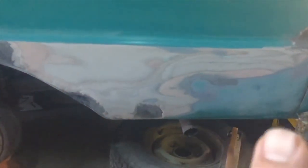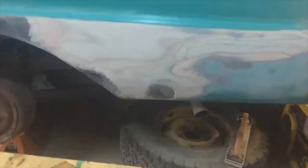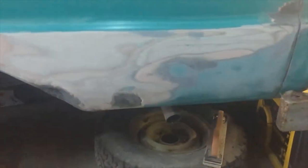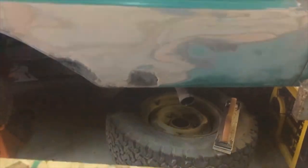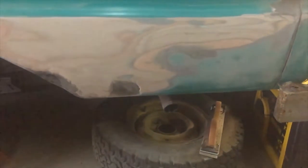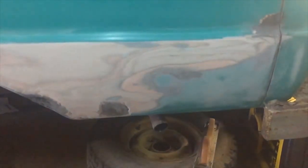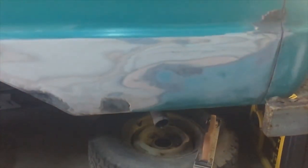If you look down there, you can see this hole right there in the Bondo, and the filler is probably close to a quarter inch thick down there. And I got underneath, I welded up a hole, that's why that's shown, I welded up a hole right there, and then I got underneath and I realized that before I got it ready to paint, it got hit. The car went down the side of it, and there's a big dent behind that Bondo, that filler there. So when I get ready to start doing the major body work on it, I'm going to grind all that out. I'm going to dolly the dent out, and then I'm hoping that when I fill that in, it'll be a lot thinner. But right there, you can see the different colors of filler that are there. And that's 40 years.